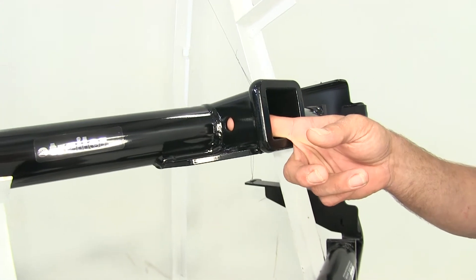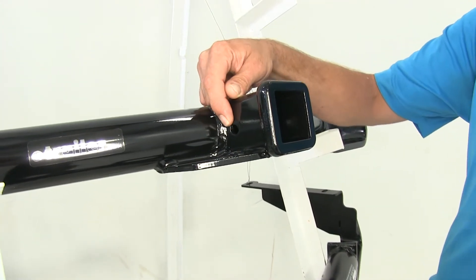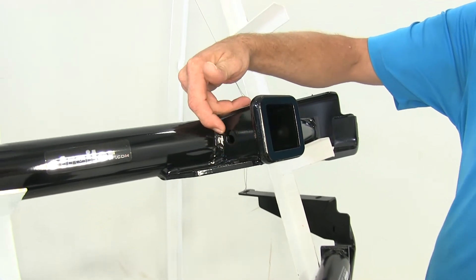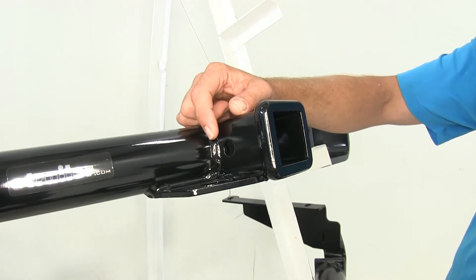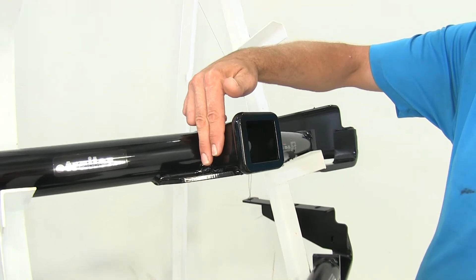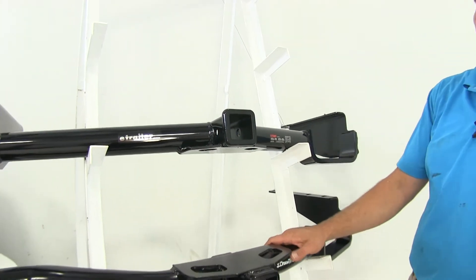The Curt is going to have a single pin hole, also 5/8 of an inch in diameter — Class 3 accessories of course. On the back side of the hole there's a little limited space, so devices that use larger washers might not work as well without being tilted a little bit. Eventually they just kind of bend into position, so it's a minor difference.